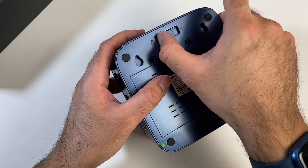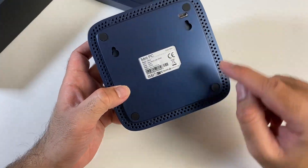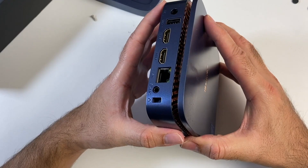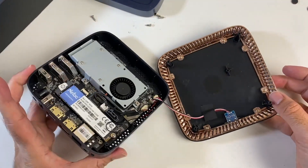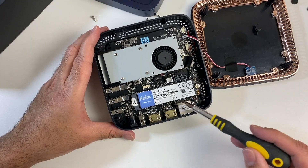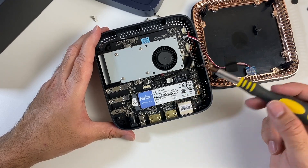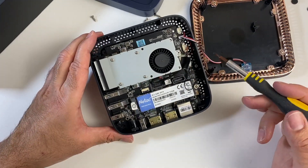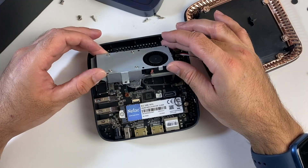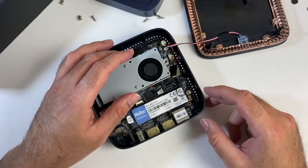There are other upgrade options too. If you unlock the top and bottom switch, you'll be able to pull the mini PC apart. You then have to remove the four sticky feet, behind which you'll find four screws. Carefully lift off the top lid — be careful because there is a cable attached to the board for the LED lights. Inside you can see a 512 gigabyte SSD which you can swap out for up to 2 terabytes, though you'll need to install the operating system yourself. There's a fan right on top of the processor, and the RAM appears to be fixed and soldered onto the board, so it's not upgradable. Removing three screws gives a look under the heat sink fan — that's the processor with thermal paste on top, and there's an exhaust on the side. Quite an interesting layout.